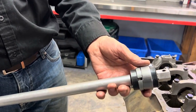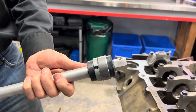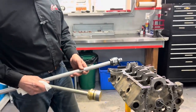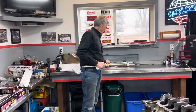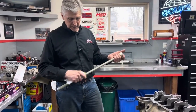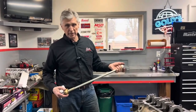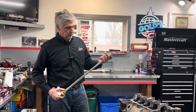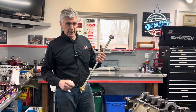It's a bit of a tricky operation, and you have to be sure you get the bearing in the right place. I came across this tool, which is an All-Star tool — and All-Star's not paying me to say this, I just bought it because it works nice. The only bad thing about this tool is it only works with small block shafts. There may be other All-Star tools made for other engines, but this one's made for small block shafts. I think I only paid about $75 Canadian.